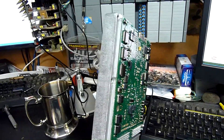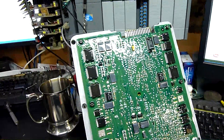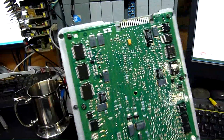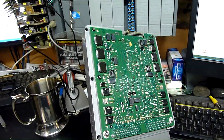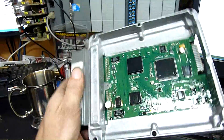I've got a feeling it's going to be an injection issue - fuel injectors, bad or blocked injectors. Because I've got spark, I've got compression - as far as I can tell. I'm going to make the compression testing tool tonight and try that out. But either way, if I've got spark and compression, the only other thing is fuel.